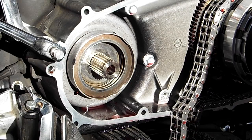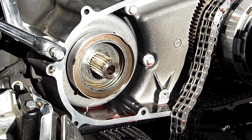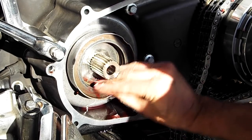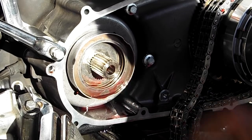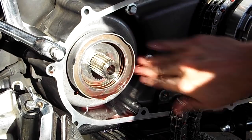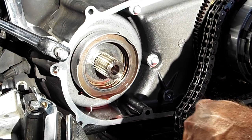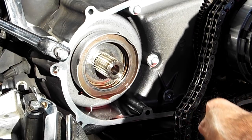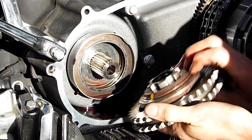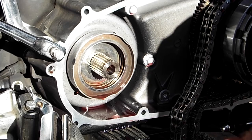Okay, I'm going to put some lube on these compensator parts before I put them together. Get some lube all over them. Put some lube right down inside the spring packs here. Get that down in there. Just get it on my fingers and scrape it off. Just like that. Let it run down inside that. Now, if I remember right, getting this back together, lining up the sprockets with each other, and keeping them that way. There we go. Okay, so this is it with it fully assembled again. And again, I got everything pretty much lubed up by the looks.